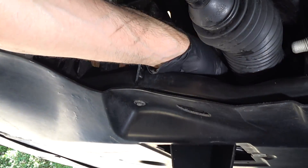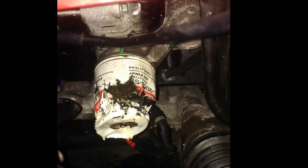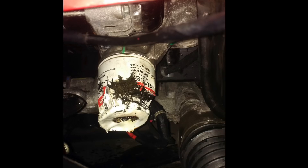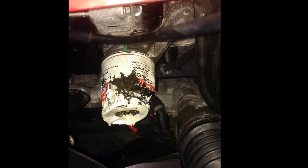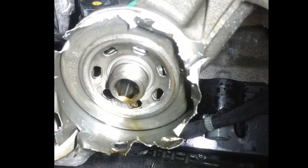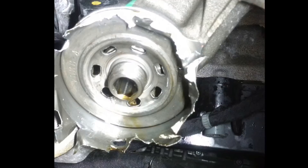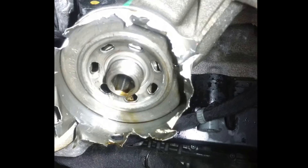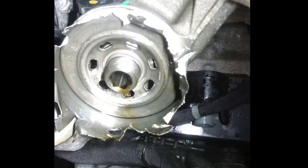The oil filter was completely seized onto the oil pump. The more I tried to get it off, the more it started to crush and crush. I tried every single tool and every single technique imaginable to get this oil filter off. It looks like the technician must have torqued it down with an impact gun. I ended up heating up the threaded hex stud coming off the oil pump with my heat gun, then used my breaker bar and a hardened hex drive bit and was able to slowly and carefully break it free.